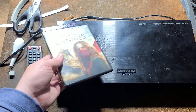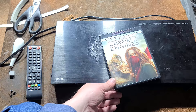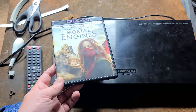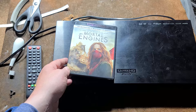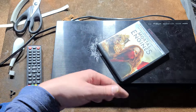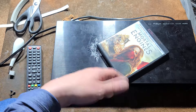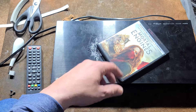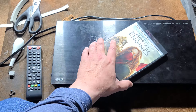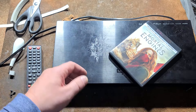Once again, this is really an issue only encountered with 4K Ultra HD players because the drives can spin up to 5,000 RPM to start transferring the massive amount of data on inner tracks. Standard Blu-rays, CDs, and DVDs just don't spin fast enough. People familiar with the older CD and DVD-ROM era may remember drives like 100x speed, which would spin a CD near the point of explosion — those had tremendous amounts of vibration shaking your whole computer because of the RPMs.